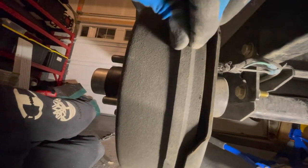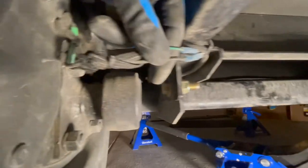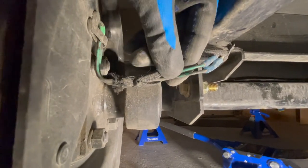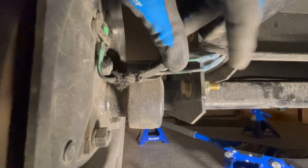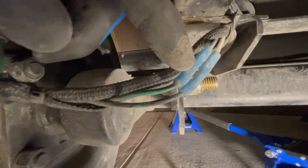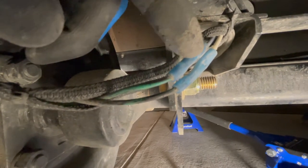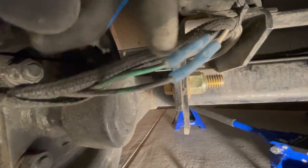If you're going to replace the whole brake system — meaning the drum and the pads — it would come with two wires sticking out of it. As you can see here, they're both green, so it doesn't matter which wire goes where. What we're going to do is try to take them off as gently as possible so we don't waste any wire. I'm going to try to get some pliers and recrimp these the opposite way so the wires hopefully just slip out.